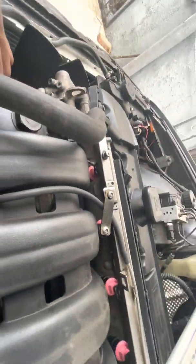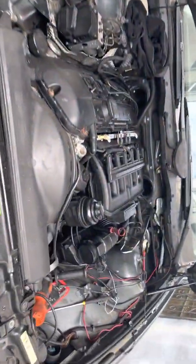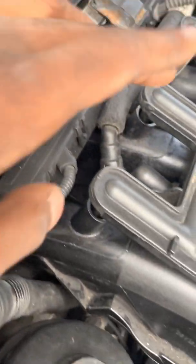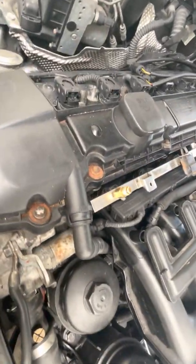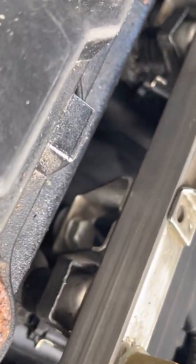My third step, and one of the most difficult, was modifying the fuel rail. To get my fuel rail on — I had to cut — there are these little mounting stands, one and two, that hard mount the fuel rail onto the physical intake so it can't go anywhere. So I had to take an angle grinder and very carefully erase those and just delete them — they're not there anymore.